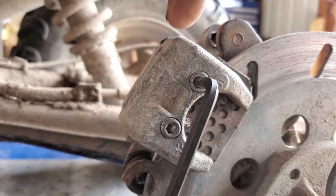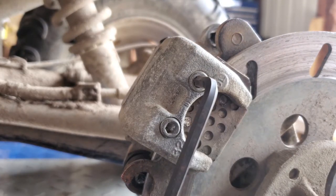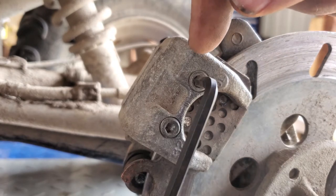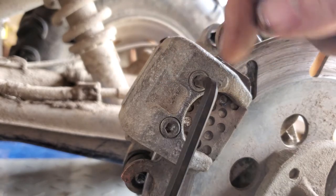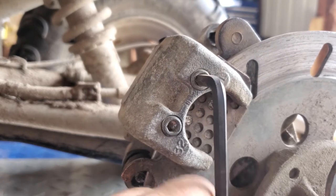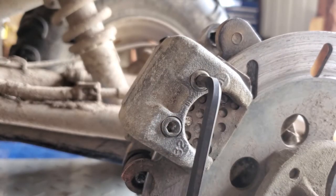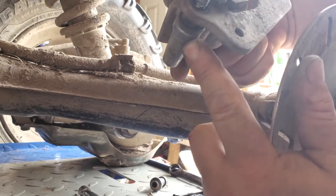The two pins that hold the pads in are right there - this one was a little bit seized up. Those pins go all the way through the housing. The threaded part is out on the face, so what I did was hit it with the propane - a little bit of heat around this area. Don't heat the actual bolt; you want to heat the metal around the bolt. A little penetrating oil and it's tight but it's spinning. You can go at it like a gorilla and strip it out, or you can be patient and do things the right way. As it turns out, we've got a seized pin here, which explains why the brake wore so badly.